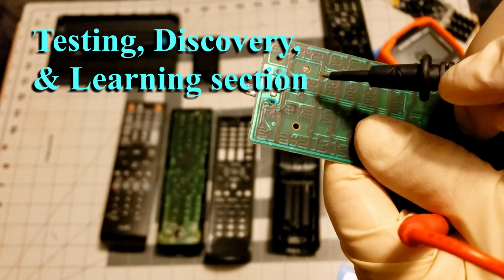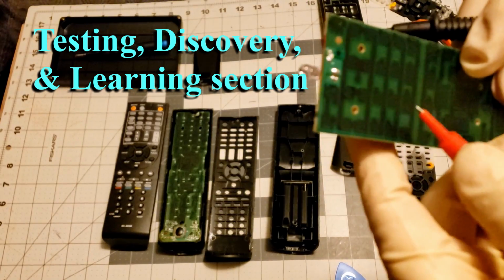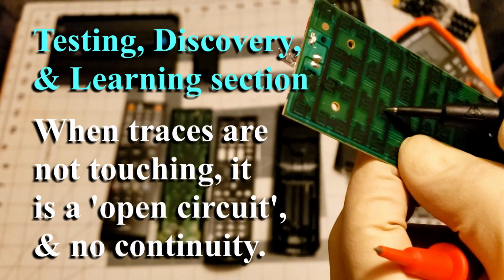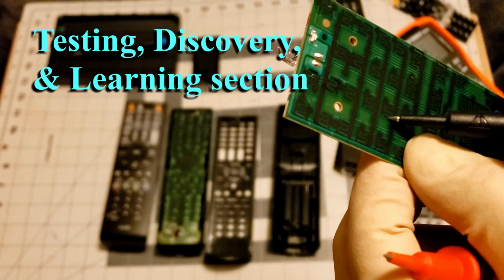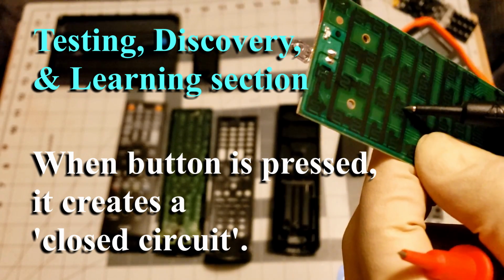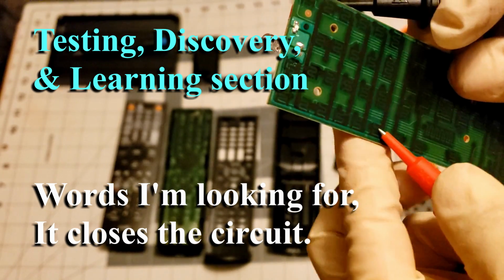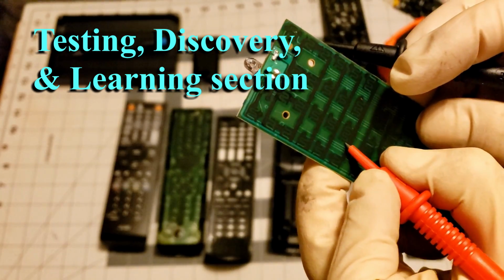Each one of these little sections is where the buttons are lined up. Okay, so my idea is thinking, and you can see the traces don't contact, the bottom traces don't contact with the top traces. When the buttons press and it touches this trace here to this trace, there's two traces on the bottom, two traces on the top. Somehow when the button presses, even though there's nothing that's creating the circuit there, it makes a button function.